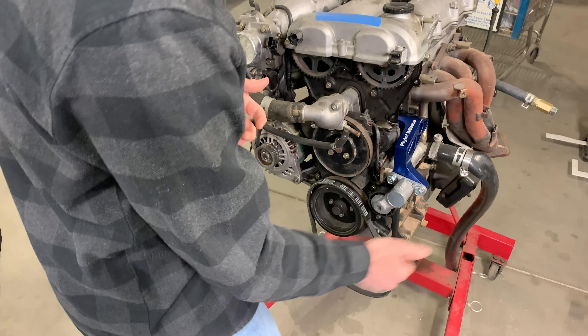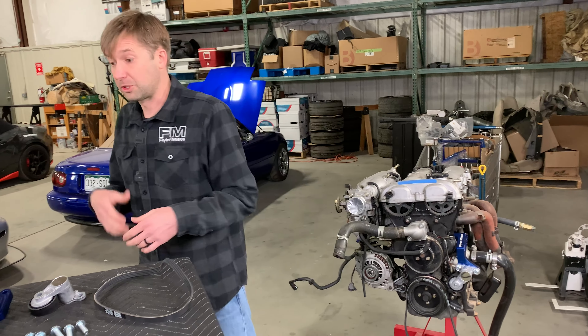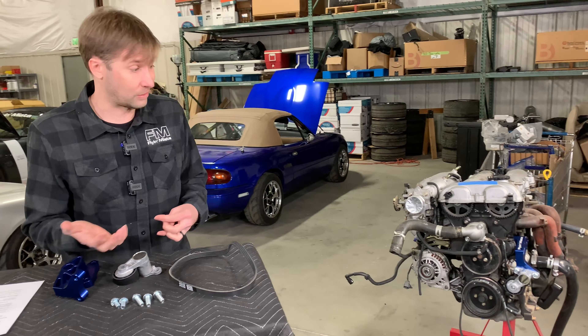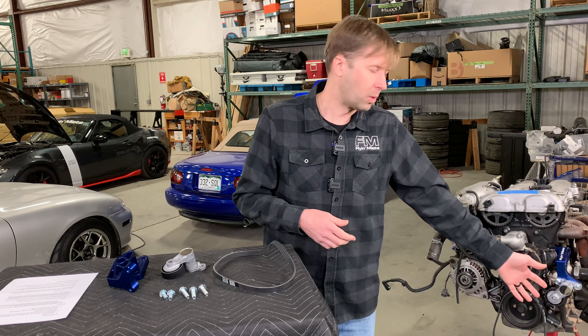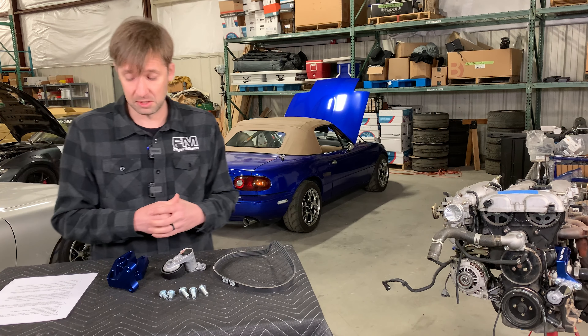However, our friends over at Leroy Engineering have. They removed the belt altogether, so it's not necessarily a direct comparison. That said, if your air conditioning compressor is turned off, your pulley is just freewheeling, so the drag is very, very minimal. In their testing, they actually found almost a five-horsepower gain by deleting the power steering pump - or rather by deleting this belt altogether, which effectively means deleting the power steering when your air conditioning is not on. So that's not insignificant - a little more than I would have guessed, frankly.